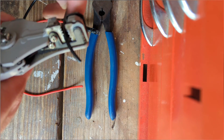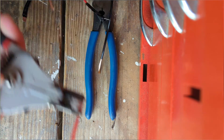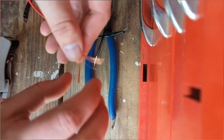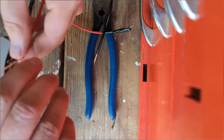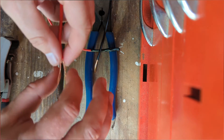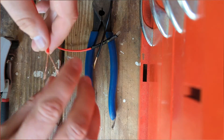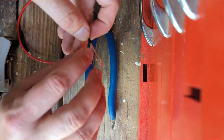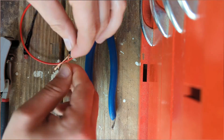We're going to do about an inch over here — something like that. With the military splice, you want these to be separated into two strands because we're going to pigtail it one way and then the opposite way to create a really tight connection. This connection is not going to see a lot of stress, so we'll poke that through the opening that we cut in the main harness. Tie the two pigtails kind of closely together because they're going to need to go through the same hole.